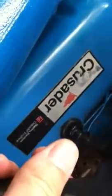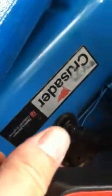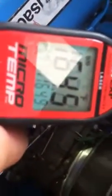Alright, so if I take my infrared gun, I'm hitting the top of the thermostat housing, right on the little brass bleed screw, and I get 144 — about 154 in that range. So the gauge reads 180. And let me also hit the temp sensor that screws into the block. That's nice shiny brass, and I get 164 on that.